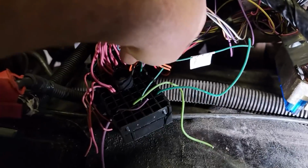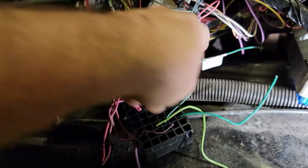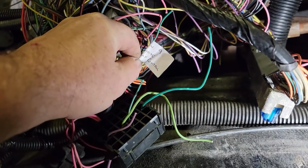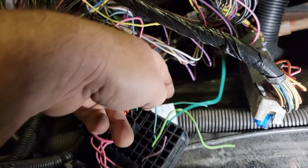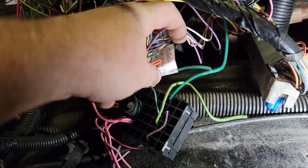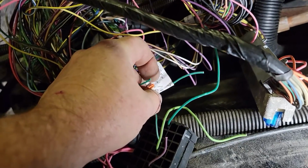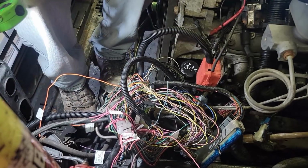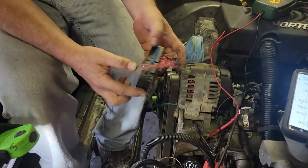So then I'm cutting it out of the block that went in the fuel harness, and I match it up, make sure that the color's the same, and then I mark on this little tag what exactly it is. Green connector, pin number 9, so on and so forth. Cut that off, it's the last one, so I don't need that anymore.